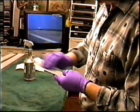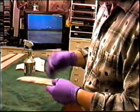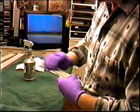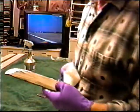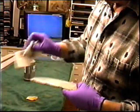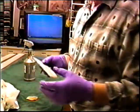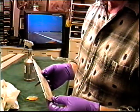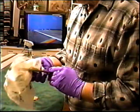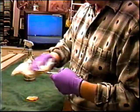But what I wanted to do, because we're trying to do this with no filler at all, I'll do one up under the camera, to give you an idea of just how much effort goes into getting this coat of silver off. Using 500 sand, no, this is 600. I had 500 before. I was going to try some 500 and then I punked out. What happens with rougher grits, it leaves sanding scratches and you have to do it over with 600 anyway. But so far it looks like this coat of silver acted as we suspected. It's showing the little tiny flaws.